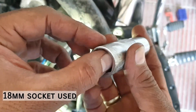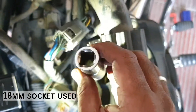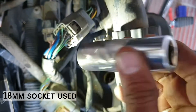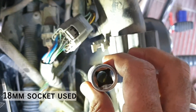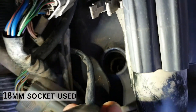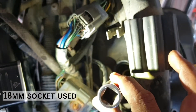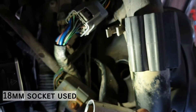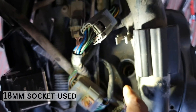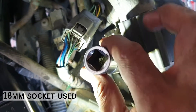The wall thickness of this socket is thick, as you can see. Because of this thickness, if you try to put this socket — even though it is the right size — into the hole and try to unscrew the spark plug, it will unscrew, no problem. But the chances are high that this socket can get seized into that hole, which is of the exact diameter of the socket. So before starting this, especially these kinds of jobs, you have to make sure that the tools you are using can go in and come out easily. Just imagine if it got seized — that would be a nightmare to repair. I have ground it down here so that it can go in and easily come out so that it doesn't seize with the body.